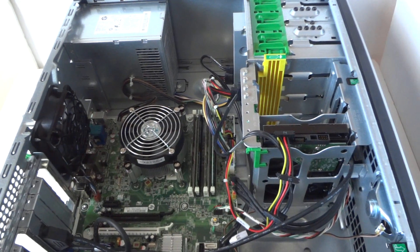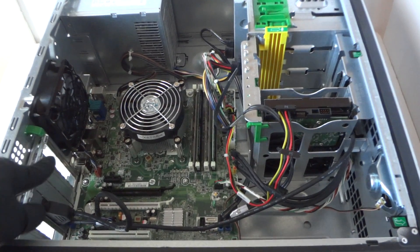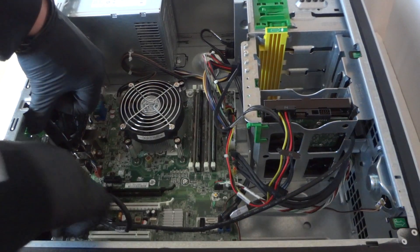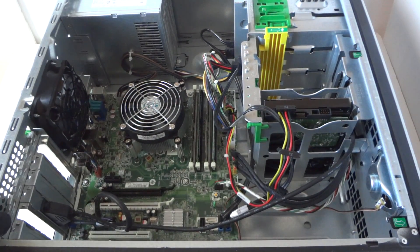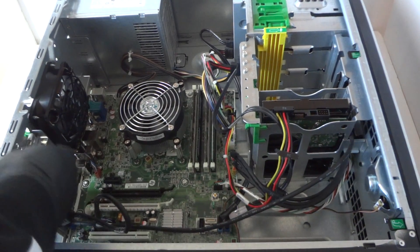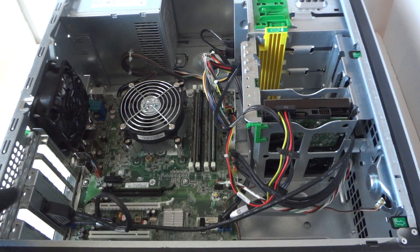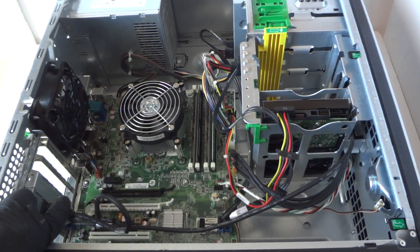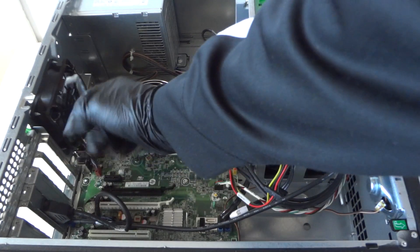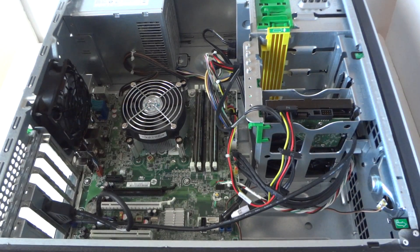I'm going to move the camera down. There are clips right here — press on them carefully — and one in the bottom to release the expansion slots. We're going to remove the PCI bracket for the video card. If you're installing the GTX 950 mini, you remove one PCI bracket here and a second one right there. Let me show you how to do that, and then I'll get the video card.